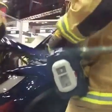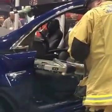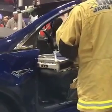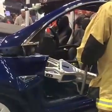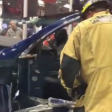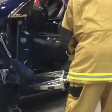Again, not your typical construction — we have aluminum on the hinges and the hood skin. So it's not really what we're used to. What you'll see with the fender is that as it's being removed, it behaves differently than our steel construction. Oftentimes the sheet metal on an aluminum body structure vehicle will break rather than bend out of the way. As you can see, the way that's peeled down is a little different than what we're used to seeing with steel construction.